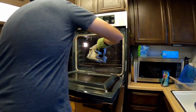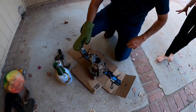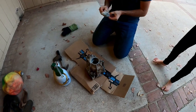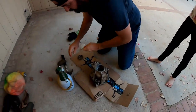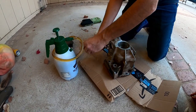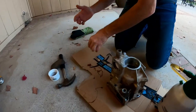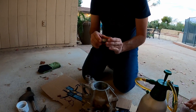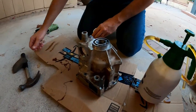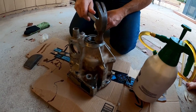One transfer case nose cone — look out, it's hot. That is super duper hot and the bearing is super duper cold. I'm going to get a little bit of gear oil on this before we do this — just a tiny bit, that's plenty. I've got a piece of PVC pipe. Center that up — wow, it's practically falling in. The hot and cold is working.